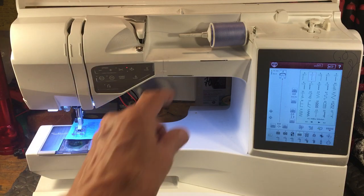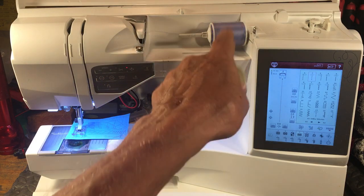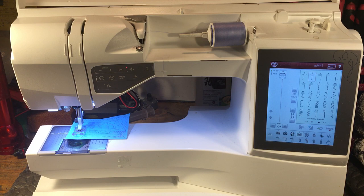So get your right spool pin. You've got three of them on there, use the right one. If not, order one. It has to be just larger than the spool or it'll cause a malfunction. It'll keep your machine from working properly. It'll tear your machine up.